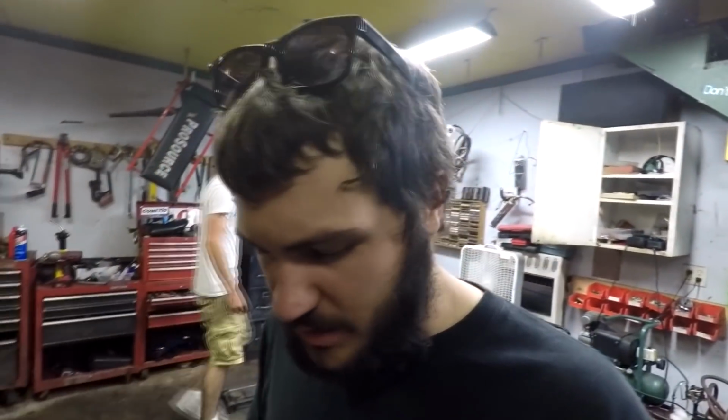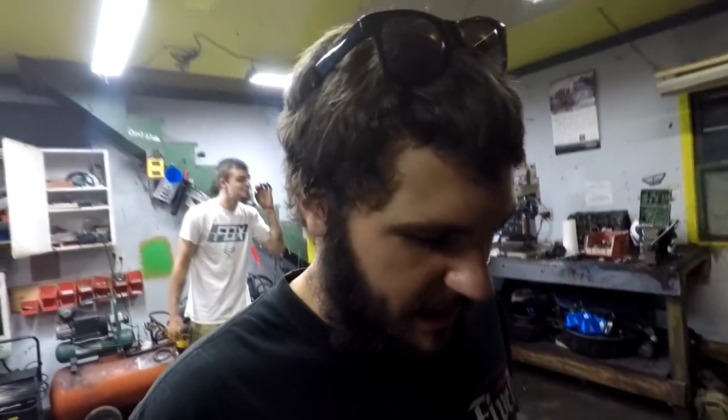Okay, so today we have been working on the Integra. Last night I worked on the Integra and we got the car fixed. I didn't really film the process. I ended up live streaming it last night and figuring out what the issue was, because one of the subscribers messaged me on Facebook and said, "Hey dude, I've had that same exact clacking noise and it was the VTEC solenoid." So I pulled the VTEC solenoid off and put a new one on, and this thing runs like butter. It doesn't have any idle issues anymore. It doesn't have pretty much anything wrong with clacking, nothing.